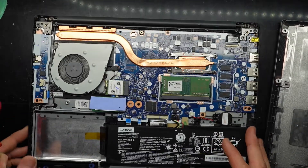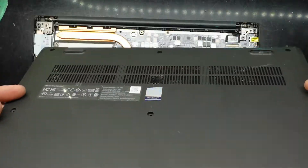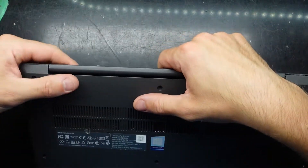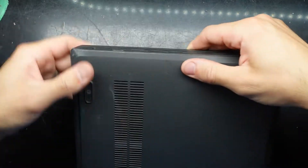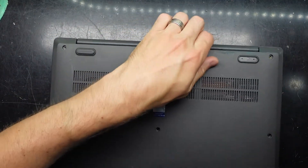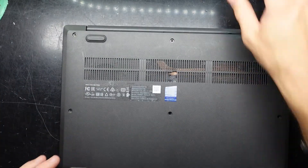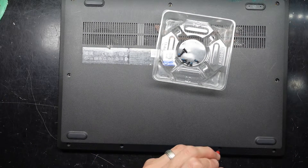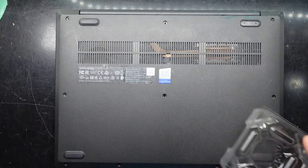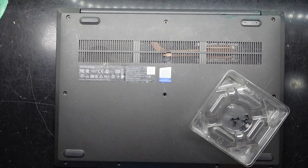With all that sorted out, put the back cover on — line it up over the top, start in a corner and pinch down. If you need to squeeze more, fold it open so you don't damage the screen, and work your way around. Then install the four smaller screws along the front — one, two, three, four — and the remaining six screws across the back. That's how you open up and replace the NVMe, RAM, battery, and a few other things in the IdeaPad S145. Hope this helps — see you later!